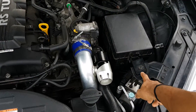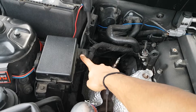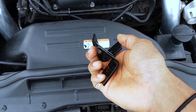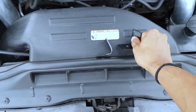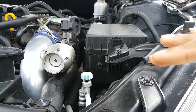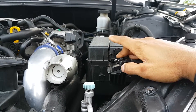The first mounting location will be right here in this fuse box, and the second location will be back here in this fuse box. You're going to need a pair of 90-degree brackets to mount your catch cans. If you take a closer look, you can see that one of them has been slightly bent — if I had mounted it as-is, it would be at an oblique angle. So in order to mount it straight, I had to bend the metal to make it look like this.